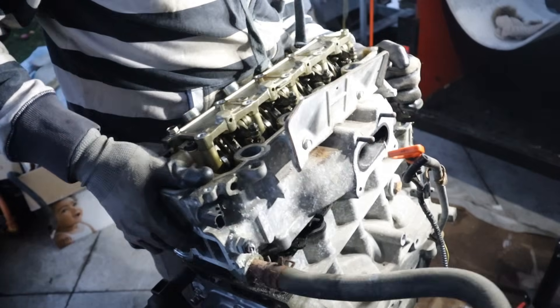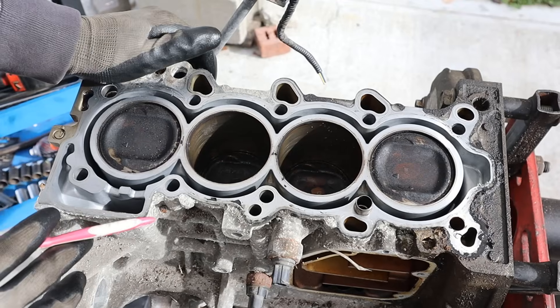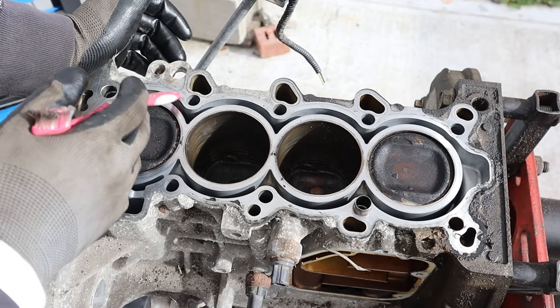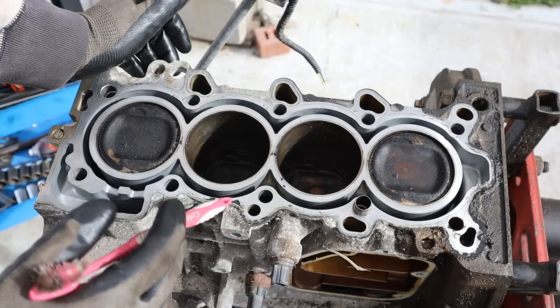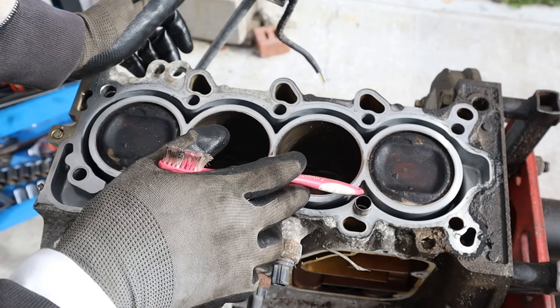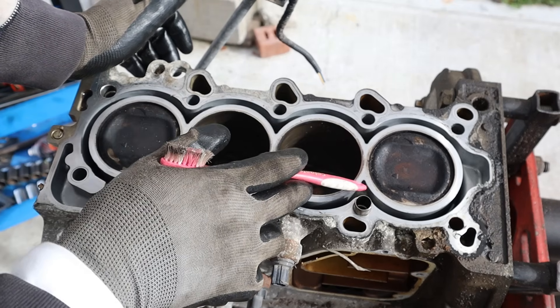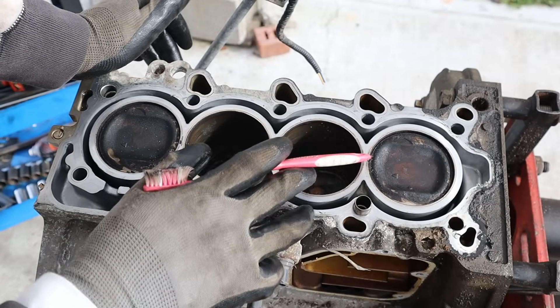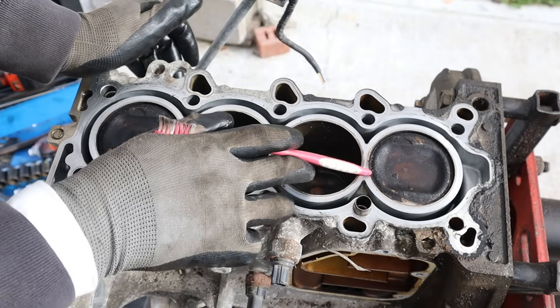I'm going to remove the head now. After some sleep, we're going to take a look at this engine which has a completely open deck design - there are no reinforcements and it doesn't have to have them because it's a hybrid. Unlike the newer L15s that have a slit in between that allows coolant to share from side to side for even cooling around the cylinder, this one doesn't have that, so it won't suffer from head gasket issues in that thin region.